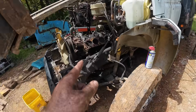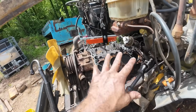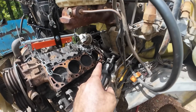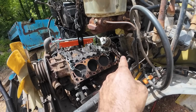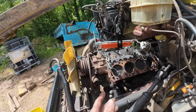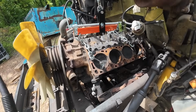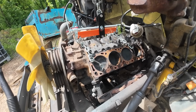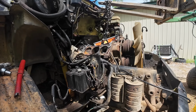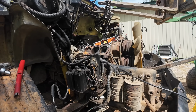Okay, I'm gonna take a pry bar, see if I can't get it worked loose a little bit. I don't really want to pull it and break it loose with the tractor, because if I'm missing a bolt somewhere, the tractor will 100% break that. So I kind of want it loose. I just want to be able to lift it out with the tractor. The sink down rate, bleed rate, pretty excessive. That's cool. You can see it, you don't even need the time lapse for it. So all my transmission bolts are out. I double checked that. Or bell housing bolts.